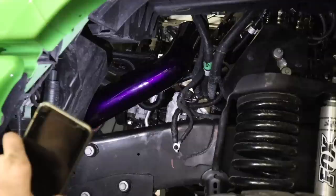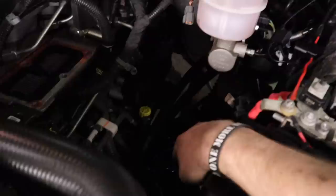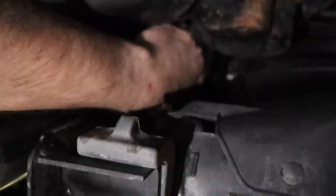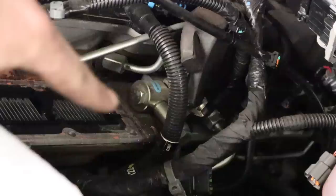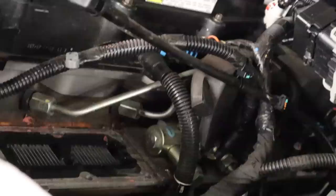That is fantastic! You can see it popping up right over here. The boot is on the intercooler now, and I'm going to run that clamp so I can actually put a socket on it. Just a tip for you guys — if you hear someone talk about your fuel rail plug, this is it. It's like a $30 mod where you can screw this one out and put one in that's a solid plug with no spring, which keeps consistent fuel rail pressure.